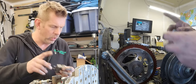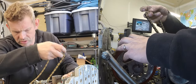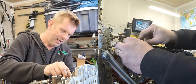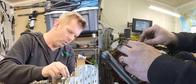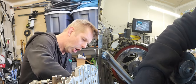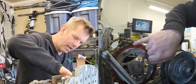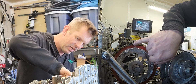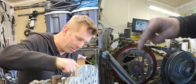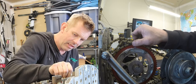Now I need to see which link I need to break, because we have to do this to get the correct link. What we want is for the narrow part of the half link — or the offset link, sorry — the narrow part has to go in there, and the wide part has to go around that. So we have to take this pin out, put the offset link in there, and that's how we're going to do it.